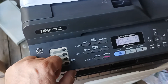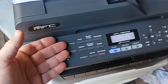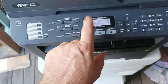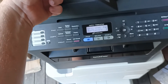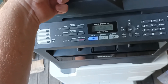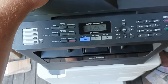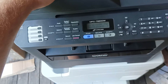The other way is to use your new Technicolor modem as a modem only, and plug in your old router directly into one of the network sockets on the back of the new modem. You just use the new modem as a modem and ignore its Wi-Fi network capabilities. It's the only way you will get an older generation printer to work with the new modem.